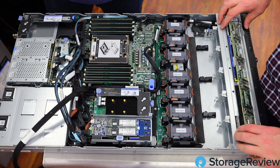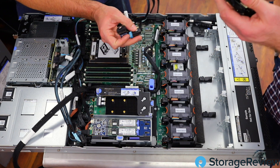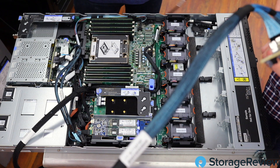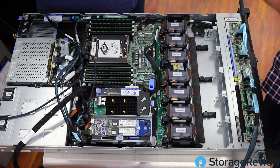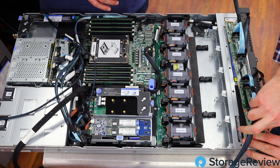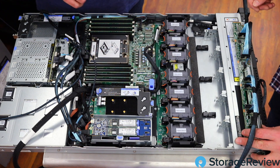We'll grab the harnesses. As Kevin works through it, you'll see PCIe 4, PCIe 5, and then on the board they're labeled really well too. The shorter one will go this way to reach these points, and the longer cables will wrap around and sneak in. That's for the back one. Then we've got two SATA SAS runs going to the RAID card. For most people running the AnyBay 10-drive backplane, you'll be using PCIe NVMe Gen 4 drives. However, since they are AnyBay, you could drop a couple SATA or SAS drives in for boot, logging, or inexpensive capacity — and that's when the RAID card comes in handy.